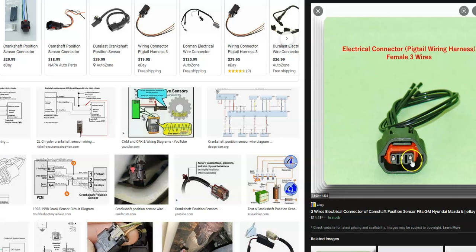Be sure to check for power. When you turn the key to the on position, you should be getting steady voltage here. If you're not, there's likely a blown fuse or an open in the wiring — but quite often it's a blown fuse. The fuse is usually located inside the engine compartment in a fuse box, though sometimes it could be underneath the dash.